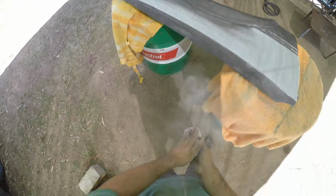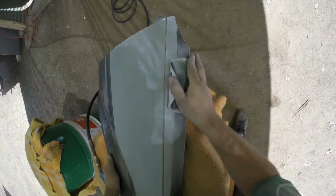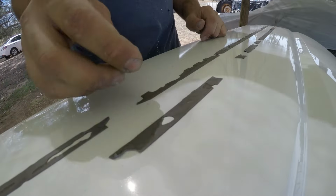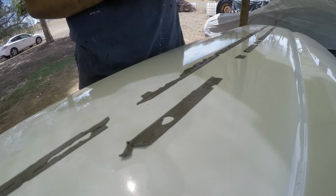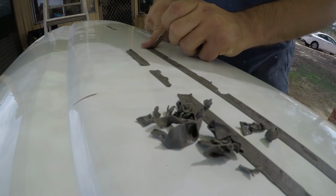Looking back at this job, one of the things that I learned throughout this process was that getting the panel gaps perfect is not an easy task. So in hindsight, something that I probably would have done differently would be to mount all the panels on the car while the car was still in primer and then get all the panel gaps perfect. The panel gaps right now, they're not bad. They're probably just as good as they were coming off of the factory floor in Toyota.